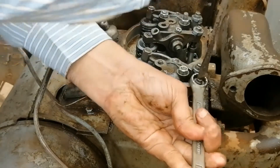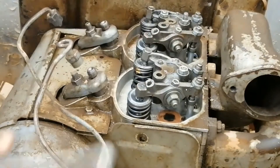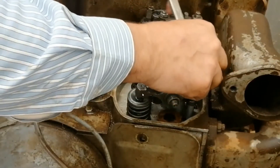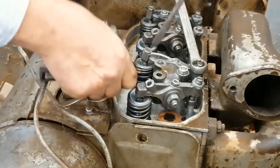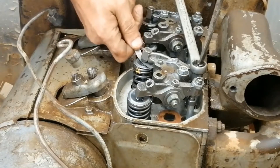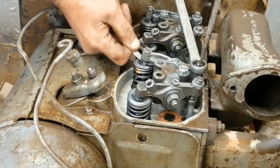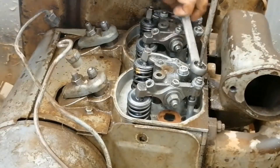After finishing, make a check. You have to feel the feeler gauge — put your feeler paper between your fingers and feel the drag between the rocker arm and the valve when you insert the feeler. For another piston: this is intake. We can identify the valve by the manifold itself — beside the exhaust manifold means it is the exhaust valve; beside the intake manifold means it is the intake valve. Finished.